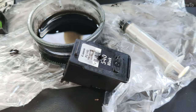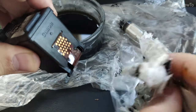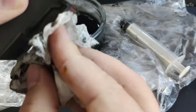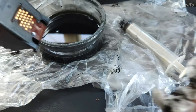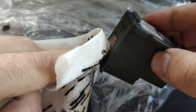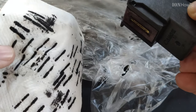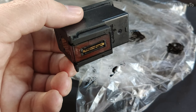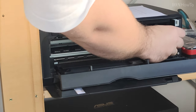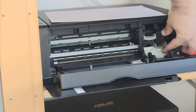You can see the line is a little bit off in the middle — not ideal, but much better than it was. Before reinserting, I need to clean the contacts and make sure there is no water on the nozzles below the ink cartridge. On the refill hole, you may want to cover it with something breathable, like a small piece of tape, though leaving it uncovered is fine for testing.